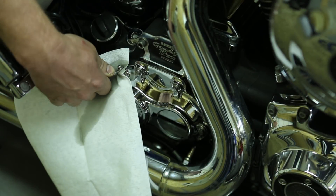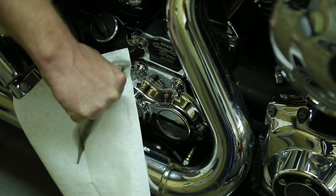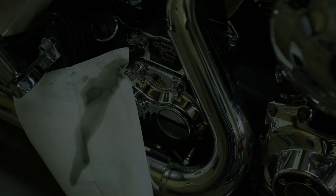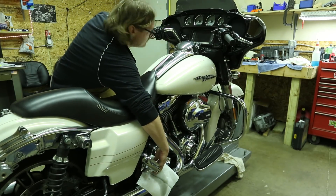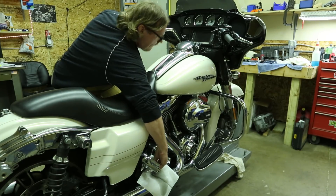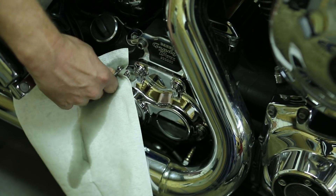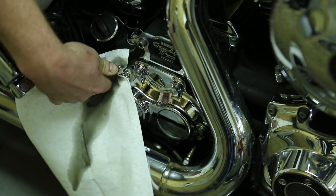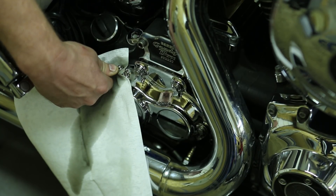My clutch is starting to feel like it has full disengagement, so we're just going to pull the master in again all the way to the bars, crack this open — still a little bit of air coming out. Close it off and re-pump this back up. Building pressure again; got the clutch master pulled all the way in and crack open the bleeder. A little bit of air coming out there, but this is good — we're getting some of this old fluid out, which you really want. You can do that just by adding more fluid until you get clear fluid coming out.